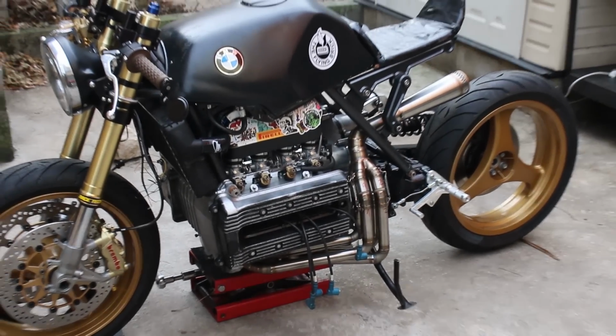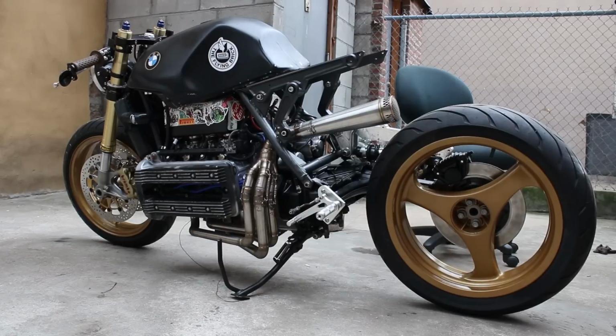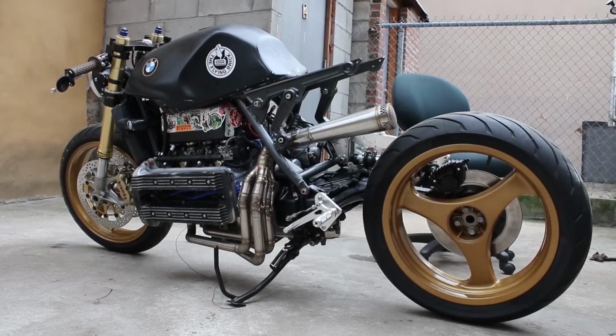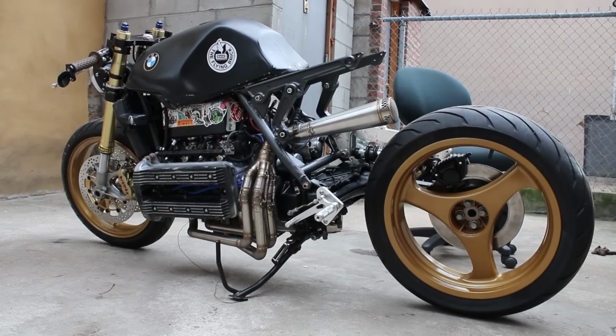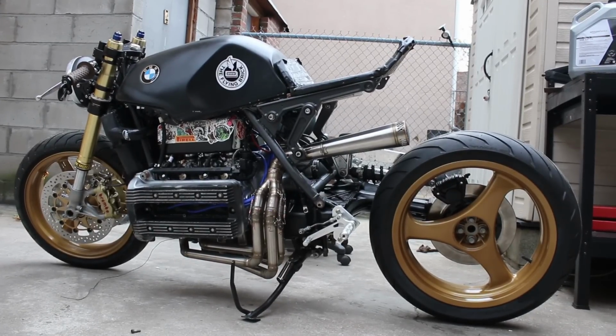The only problem is that since I have a fatter tire in the back, the muffler comes out over the tire, so the first bump and that muffler is going to get crushed. So I have to run a shorter muffler or change the angle or whatever. I just can't run this megaphone, unfortunately, and I like how it looks. So that sucks. Now, I've since ordered some exhaust studs, so soon this thing will be mounted sturdily for actual riding.